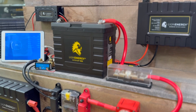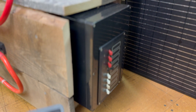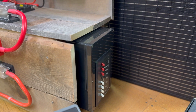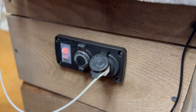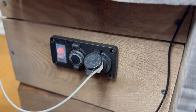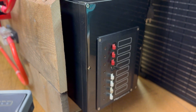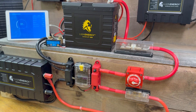In most installations you'll also have an electrical distribution panel. I've added one here on the side of my bench to power any additional loads. On the other side of the bench I added a Blue Sea Systems USB outlet for charging cell phones, iPads, and those kinds of things. It's switched both here — you can see the light illuminated — and at the panel on the other side. The breaker on the panel acts not just as a switch, but if there were an overcurrent situation it would trip, providing protection.